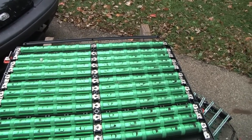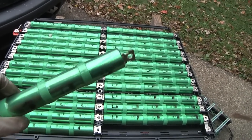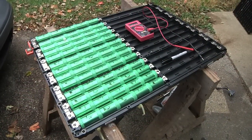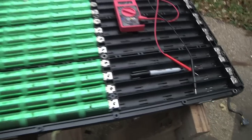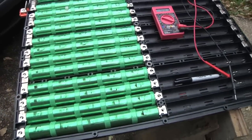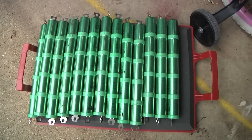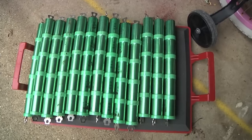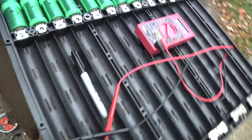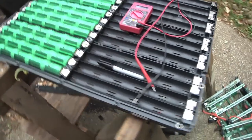Cells! And it looks like they're all shrink-wrapped together five at a time. That definitely looks like something I can rebuild into a motorcycle battery pack. I'm pulling all the cells out, and I've got a black Sharpie pen handy — I'm marking a negative on the negative side, checking that first with the multimeter, then stacking them up with the terminals all facing the same direction so I can't accidentally get to a higher voltage or cause a short circuit.